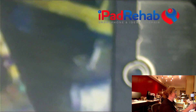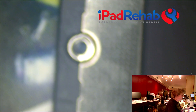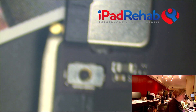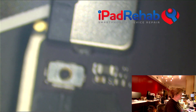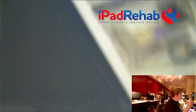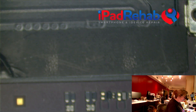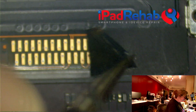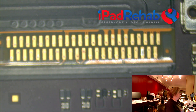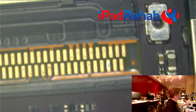Especially on the airs - the Air 1 and Air 2 - you really have to get it up off the battery or you're going to cause a lot of problems. So I isolate the battery. There's a lot of tools for that. I just use a business card. And the good news on the Air 2 is the charge port is right here on the top of the board, so we can operate on it right here. We'll pull off the sticker.